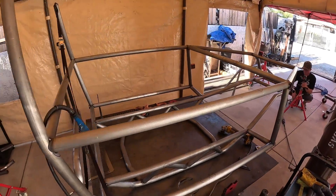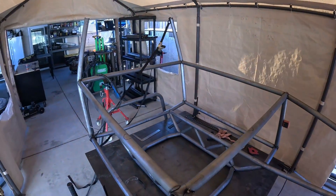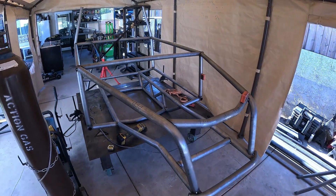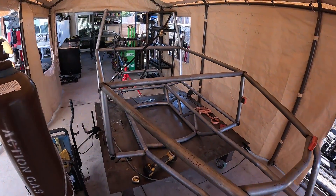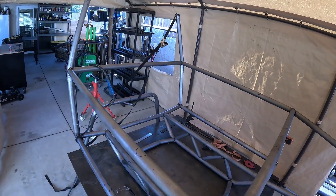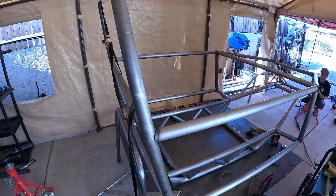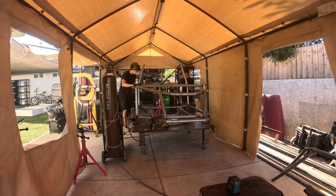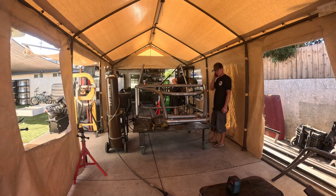Next up is putting the driver's side and passenger's side front upper tubes in place and then adding the front upper tube. Check with your laser down the center of the car making sure all your marks are in line. I'm sure I'll get a lot of crap for using ratchet straps — it's very garage fab of me, but you guys are assembling these in your garage and it's a DIY kit, so ratchet straps can be very helpful when you're trying to persuade a tube in the right direction just a little bit.